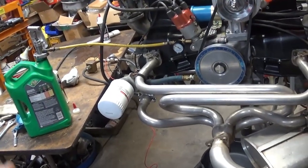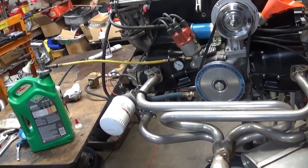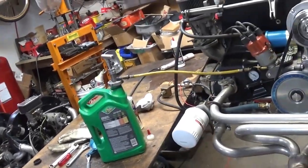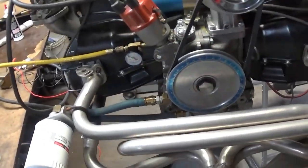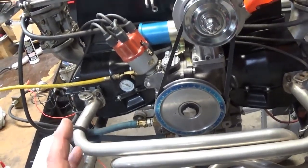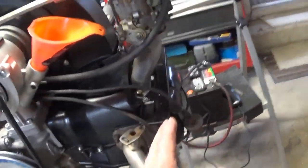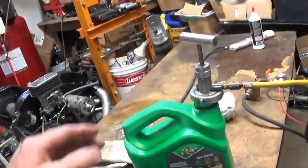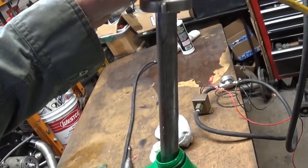We're coming down to the end here, and I was charging my system with oil. I've mentioned this several times, but I don't know if I've really given a close-up look of my pre-start procedure. We have special lubricant on the cam for the break-in. My rocker arm assemblies are not on at all. And I've got this refrigeration pump. This is just the way we used to use it when I did HVAC work.